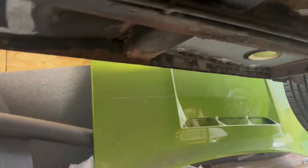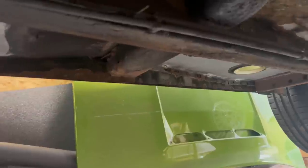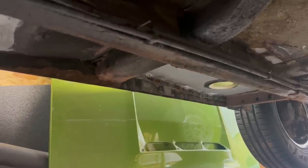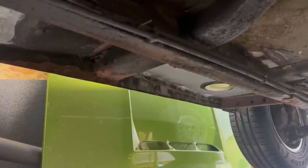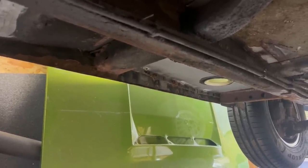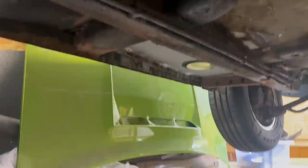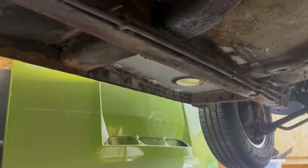But first off, I'll go and get the wire brush and the drill and the spot weld drill, and I'll drill through those old holes that I made so that the metal at the back that I go onto is nice and bright, and the arc should set up on that rather than just filling in the hole. So I'll go get my kit and get ready.